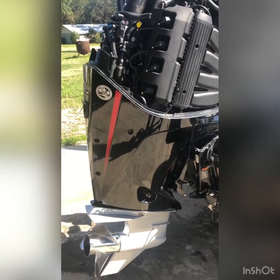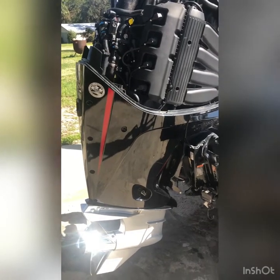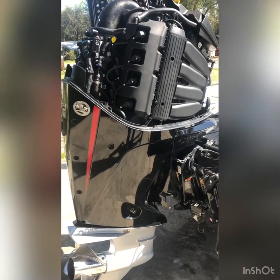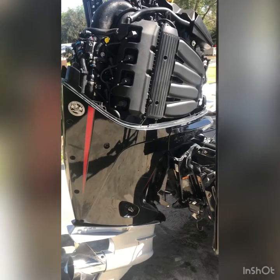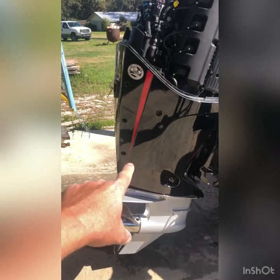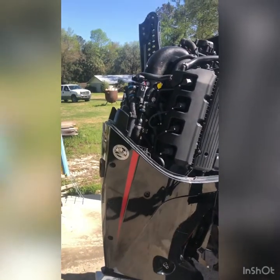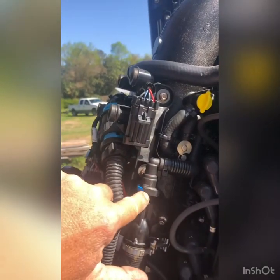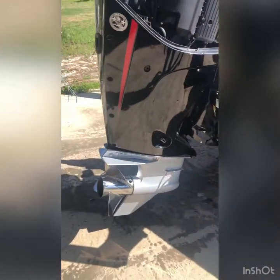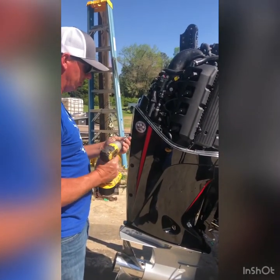What it did was it would allow you to get up to maybe about 35-40 miles an hour just on pad, and then it would overheat and put you in limp mode and you wouldn't be able to go anywhere. We're going to show you how to get around that without having to take it into the shop. We did it on the trailer, cheated it out of there, cleaned it up — there was a bunch of grass and stuff covering that filter in the mid-shaft. That's 99% of the time what's causing that problem when these two upper filters are clear and clean but this one down here is clogged up.